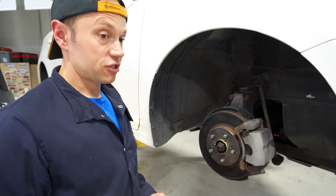I did the zip tie fix, as you can see, which held it together quite well. I also used a little bit of paint to try to cover it up. This lip has got a lot of cracks — anybody that knows fiberglass can probably fix it somewhat easily. Here's a quick way to remove a lot of the double-sided tape: I went through with a plastic razor blade to remove the top layer, and then I've got my 3M adhesive removal wheel here, which works exceptionally well.